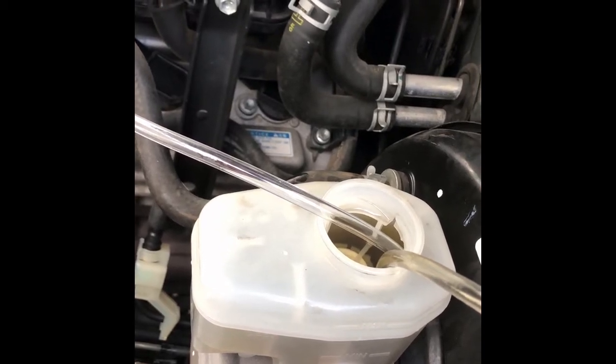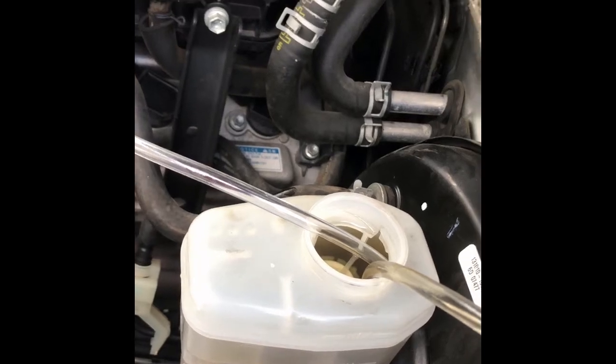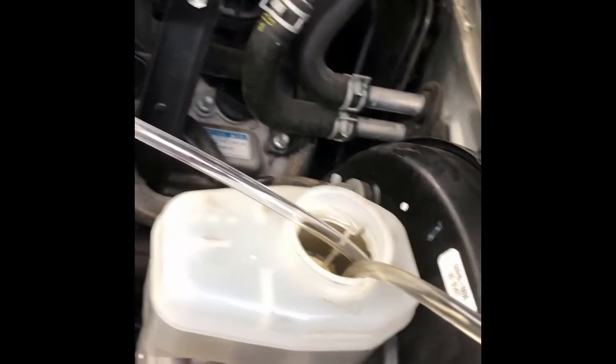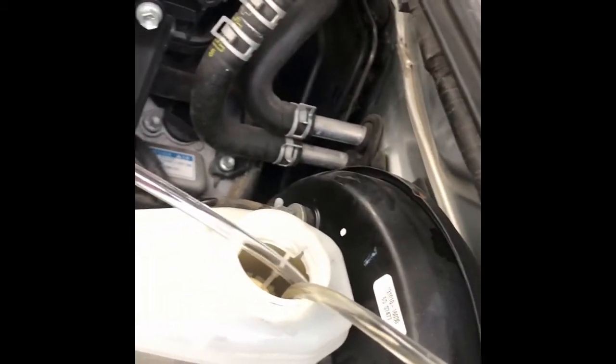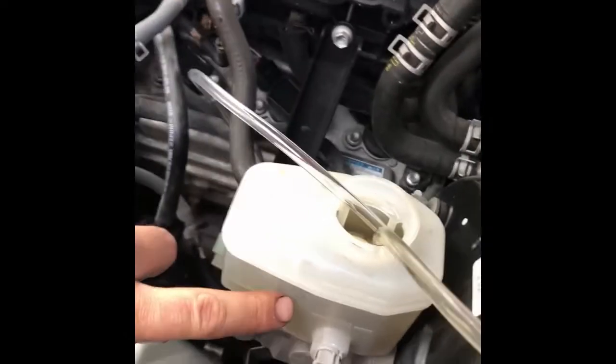I've got another video on that, but in any case, when I got the wheel back together I had that rear brake line open all day long and I should have capped it. What ended up happening is it kind of Chinese water tortured a drip the entire hours that brake line was off that wheel cylinder. I didn't realize it — I wasn't in a hurry, I had all day to do it. I pulled the wheel off, went and mowed the lawn, did all kinds of stuff while that brake line was open, and I was not expecting it to actually pull that much fluid from my master cylinder.